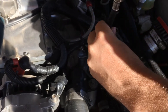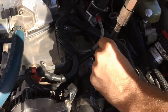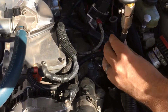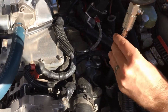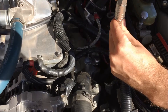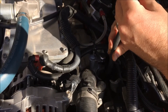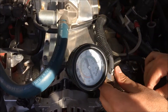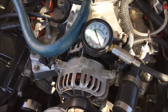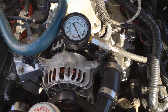You want to be careful not to cross-thread anything — if you're doing it by hand, odds are you'll probably be okay. Also remember, you don't want to be working on a super hot engine because the tool we're putting down in there is cooler. The hot metal expands and the cooler contracted metal could cause problems with the threading. Once it's in good and tight, go ahead and crank the car. We've already pulled the fuel pump fuse, and as another precaution, put your foot all the way down on the gas pedal before turning the ignition — cars are programmed from the factory that if you have the gas pedal pushed to the floor, they will not start.